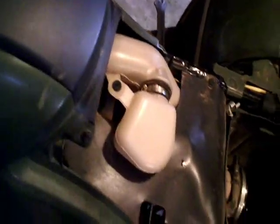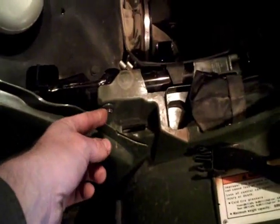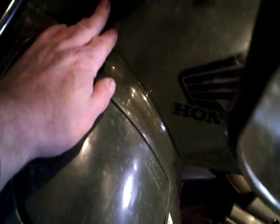Anyway, there's one on each corner of this center section. There's, I think it's a 10mm bolt there on both side covers. Another one down here. There's one up in the corner here, one up here. There's some tabs here that engage in the fender. Along on the other side there, another push clip. Another one right under there. Another one here and another bolt.